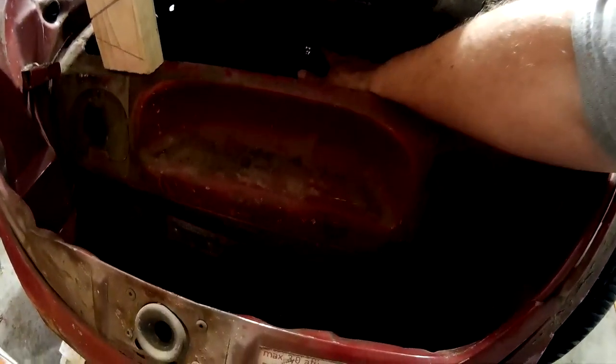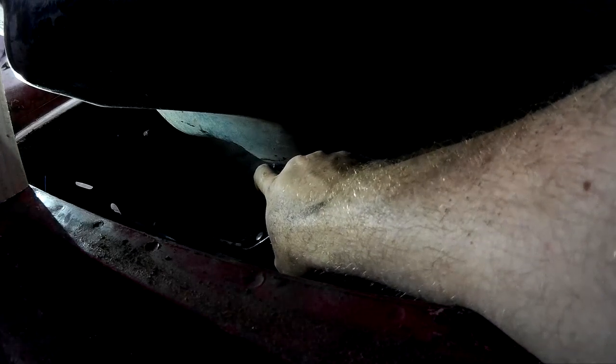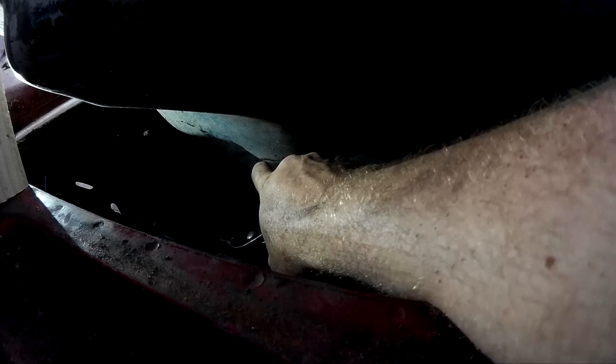I have no idea about the big nut on the bottom of the gas tank — I'm just going to go ahead and pull. There's a small hose connected to the rigid gas line that goes through the body. I'm going to go ahead and undo that one and pull it out. There's the rest of that gas. I've still got this fuel line I can stick right there and drain the rest of the fuel. It's a little big, but it'll work.